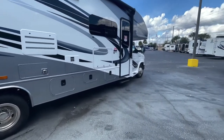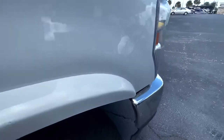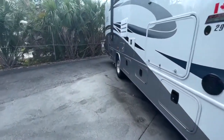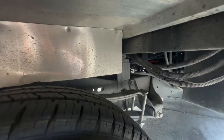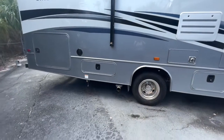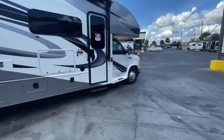And finally, your rubber isolation mounts. I believe it's about six to eight of these going throughout the coach between the house and the chassis — they look like little hockey pucks is the best way to describe them. I've got one right here, and then on the other side there's one down here as well, and another one back here on the left, and a fourth one there on the right side. Those are super important because they're going to reduce the noise and vibration from the chassis from coming up into your coach, moving up into those appliances and those blinds as you're driving down the road.